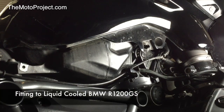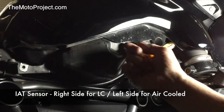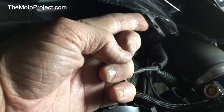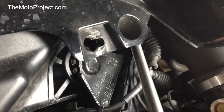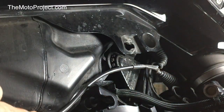Installation of the Memjet Evo unit on the liquid-cooled R1200GS is actually quite simple. On the right-hand side of the bike, of the fuel tank, what you want to remove is the plastic panel that sits down the bottom of the tank and then loosen the main side cover. Once you've done that, you can lift up the tank and underneath, just there, is the temperature sensor unit. Just behind that panel is the temperature sensor unit — you can see it up here. It's simply a matter of unplugging it and then plugging in the leads, which simply bypass it or join it to the Memjet unit.